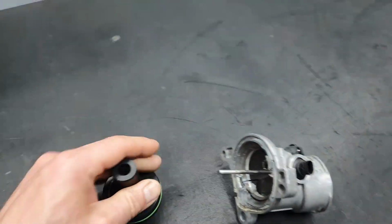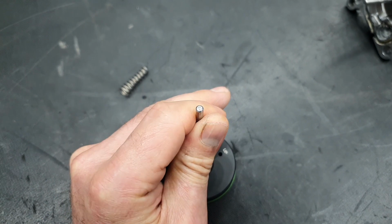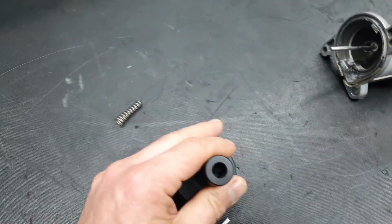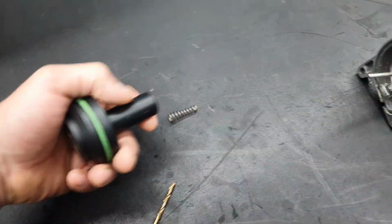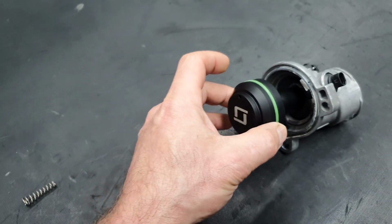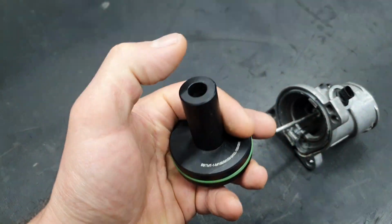That's why I'm saying, I'm sorry, I should have done that earlier, but I forgot it. Okay, just clean the inside with a 4 millimeter drill bit, blow a little bit with air to be nice and clean. It just fell down, beautiful. And then try to put it first without the spring. That means try to insert it inside without the spring and see that it's nice, and when you're entering inside, it doesn't make any sound inside.